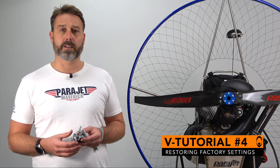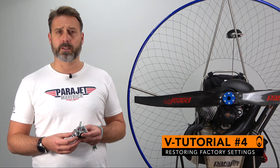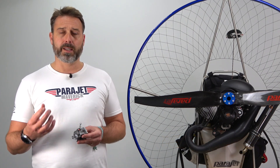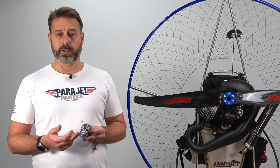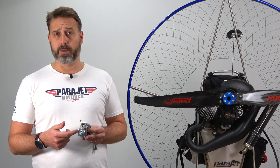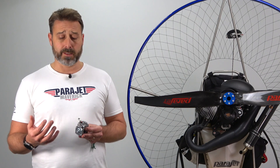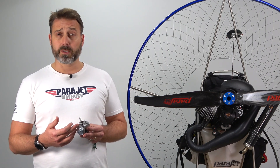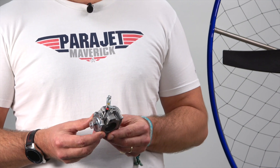In order to make correct adjustments to your carburettor, it may first be necessary to understand which settings you currently have. The easiest way of doing so is to return both screws to a fully inward position by screwing them fully closed, then reopening them in accordance with chart 4.5 of your user manual — the settings of which are a quarter turn on the low jet and one full turn and a quarter on the high jet.